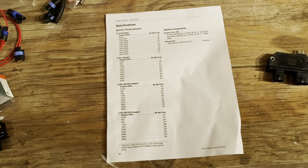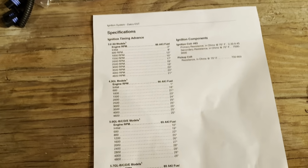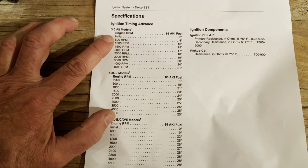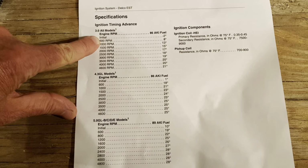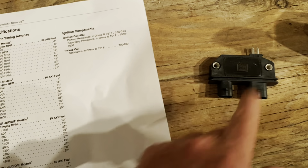I've discussed that. I'll put a link to another video where I discuss how that works in the description of this video. But I want to repeat that here. So once you set the timing with the timing tool, and once you remove the timing tool and take it off 12 volts, the module will go back to using these charts, these curves, internally. The curves are built into the electronics of this module.